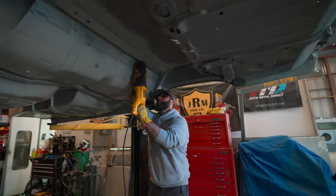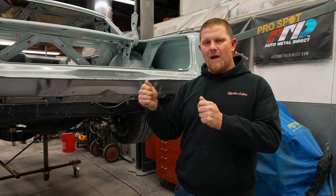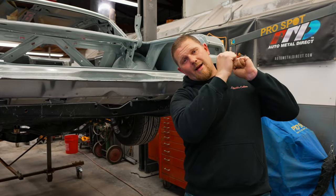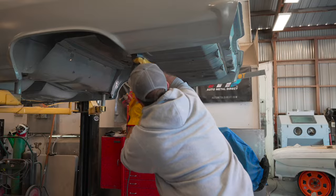Once we got the trunk pan in our possession, we verified that all of the mounts and brackets we needed were in place on the car. Once we had all those verified, we went around and marked out what areas we're going to remove and what areas we're going to keep. Have the panel close by so you can reference it, then figure out what can just be hacked out. We used a Sawzall to go in and remove the main section of the floor, so you're not in some awkward position bent upside down like a pretzel. Just cut the whole center out so you can work each section.